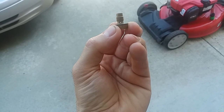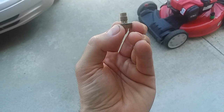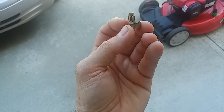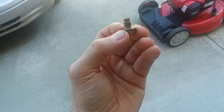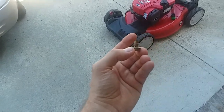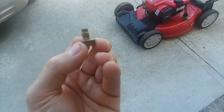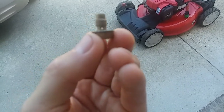So with this, even if stuff cruds up in there a little bit, there's a way for fuel to come through both sides, or even if the mower just moves around a little bit, it's going to flow through here and kind of flush it out. Whereas in this case, there is no way for anything to get out. So that seems to me to be probably another problem. Now, other people were talking about just enlarging the jet, and he was doing an experiment with that. But I'm just putting this out here as my comment on that.